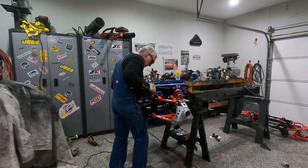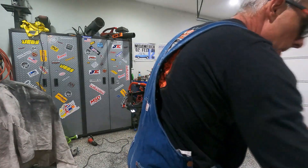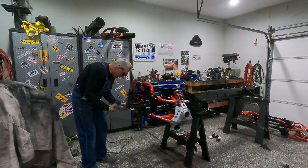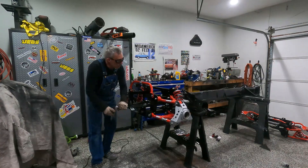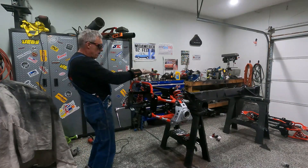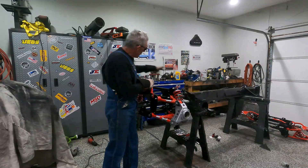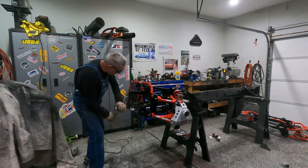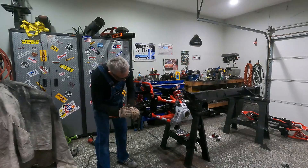All right, let's try to get this on again. I went ahead and forgot to sand underneath, so I'll do that real quick, and then hopefully this won't try to flip over again. Once I get a little bit closer — the two arms that go to the torsion bar have slots in them so you can adjust them before you tie them down. That's important because you have to measure from this corner to that corner. One side was a quarter inch off and I slowly clamped to move that one up until it was perfect, then you tighten it down.